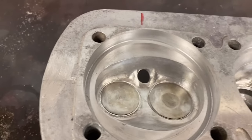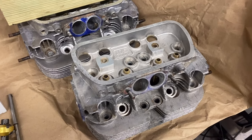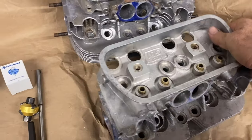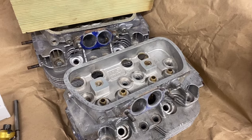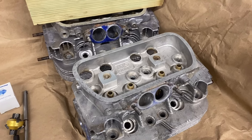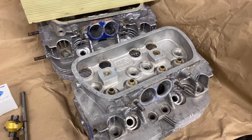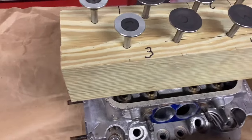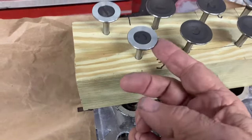These are the cylinder heads I harvested off of my cheap Craigslist Volkswagen engine. Even though they look dirty and corroded, somebody had rebuilt this motor — it was a 1600 — and left it out in the rain, filling up one of the cylinders and making a mess of things. But when I took everything apart, there was still assembly lube on everything. The motor had never been run and these were brand new heads. So the valves were already in good condition — new, never run. I really didn't have to worry about cutting the face on them.